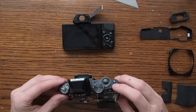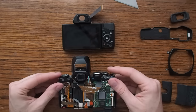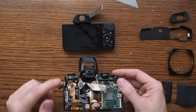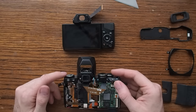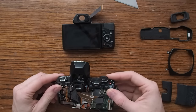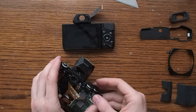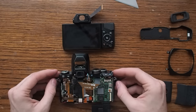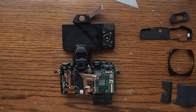If you find that your dials are skipping or stuck, that can often happen if you get dirt in there, or especially any sort of conductive contaminants like salt water — it can cause the mode dials to start glitching, and you could rinse them out. And that is the big repair that I did on both of my broken cameras. Both of them had been exposed to salt water and a couple of different things shorted out.